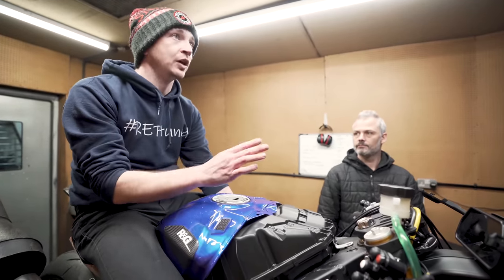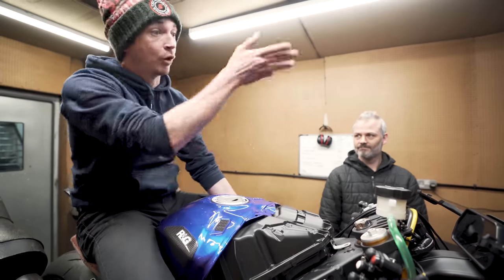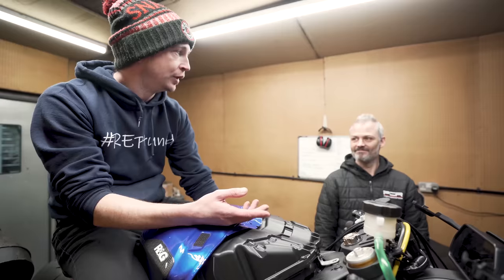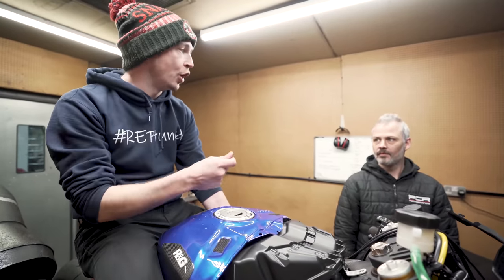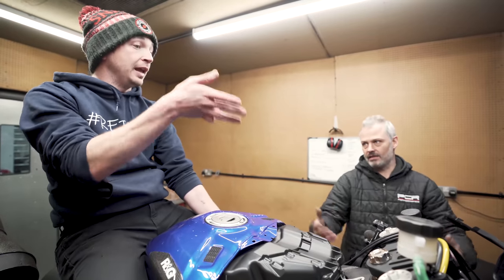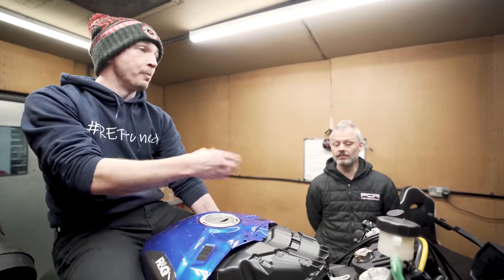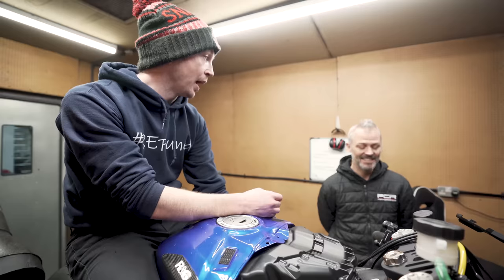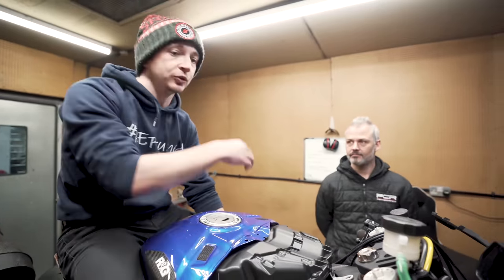So the big telltale for me is you go and watch a Stock 1000 race at Donington out of Coppice along the big roller along the back straight, they all wheelie, and none of the superbikes do. Because every superbike, they just pull the torque down at that point. The chassis is much nicer, the geometry is set better. That's the adjustability you've got. Like we were saying earlier, about mine, it would be lovely to go into mine and tweak the engine braking maps, but I can't. On the RCK kit, I have that adjustability, but I also have the data to back it up.